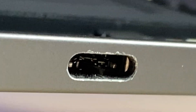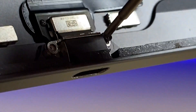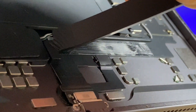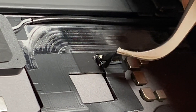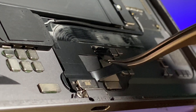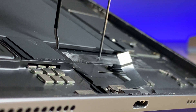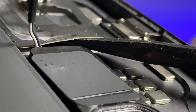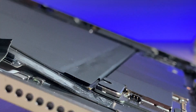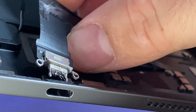You can see how damaged this charge port is. We'll disconnect the screw for the battery and the two screws next to the charging port. We'll pull up this little spacer, pull off the sticker, and pull out this connector. Disconnect the speaker, carefully add some isopropyl alcohol, and with my spudger I'm going to carefully get under the flex cable and pry it up. Now you can really see how damaged this charge port got — leave in the comments what you think happened to it.